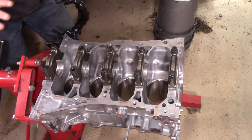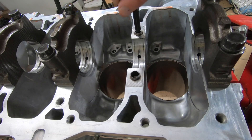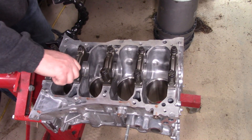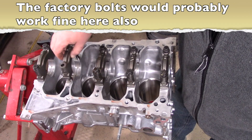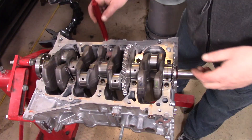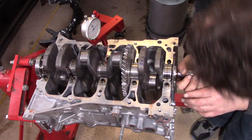Let's flip it over. The bores were 100% aligned within the precision of their equipment. These main caps took a whole bunch of searching, but I also found these main cap studs. Now they're not perfect — ARP tends to spec that they want one and a half to two threads to stick up above the nut, and if you look here it's actually about one thread down. We're just gonna machine those down about one to one and a half millimeters and they'll work great. Before going any further, we're gonna use this opportunity to check that our new crank is perfectly straight. For that, we're gonna use these old bearings — just put one at each end and swing an indicator in the middle. I'm getting absolutely zero visible deflection, so I'm going to make the assumption that this crankshaft is straight. I figured it would be, but it was worth a check.